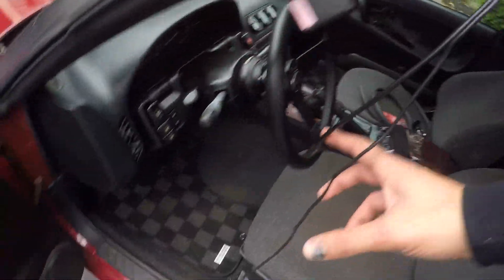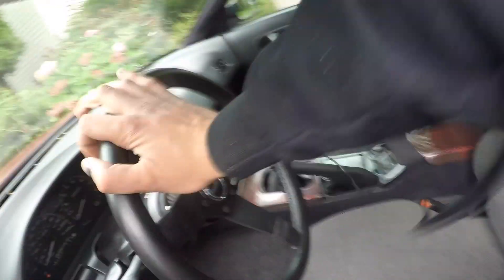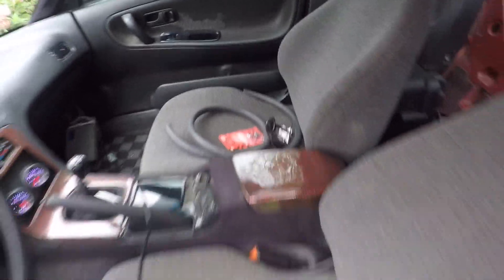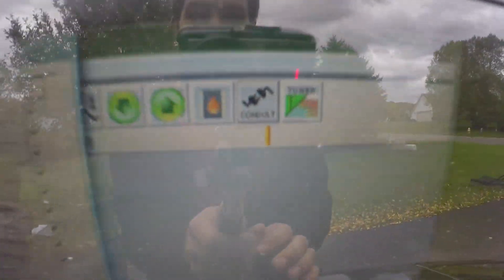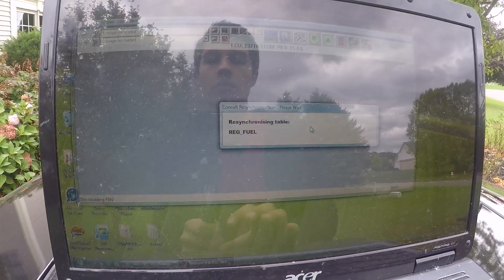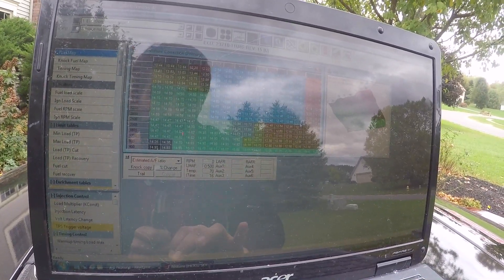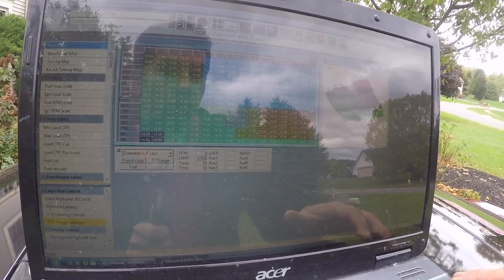We're on this tune here, got it all running. We're connected, and this is basically just showing us what we're going to be seeing — drawing everything from the ECU to the computer here. This is the load portion. RPM. And then we're going to go ahead and reduce the fuel. Alright, so that looks a little bit better. Now we're not as rich as we were up top.